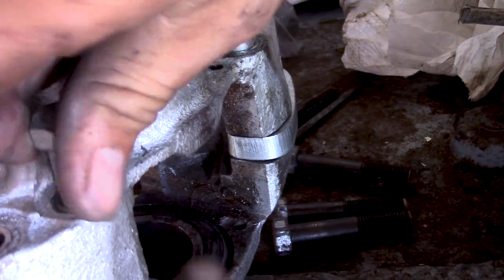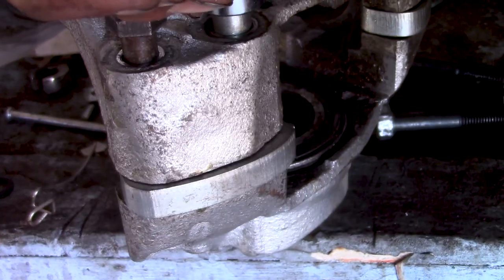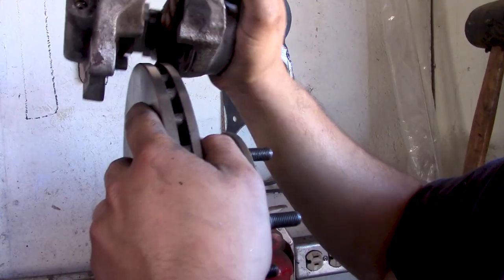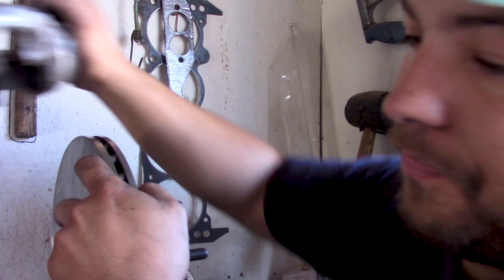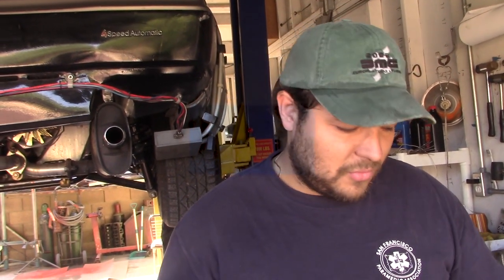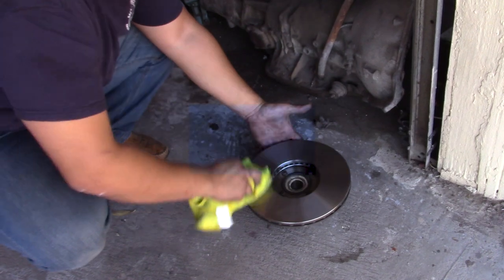The spacers might not look like they are a fit — they might be a little bit off, but essentially their job is just to make the caliper a little bit wider. See how they don't sit flush? It's okay. The rotors usually come with a coating so they don't rust while they're in the packaging, so you want to use some brake cleaner and rub that off, just so your brakes perform like they're supposed to. It removes any kind of oils and residue.